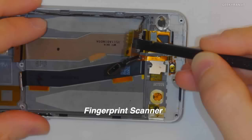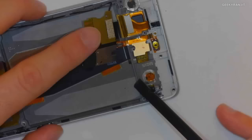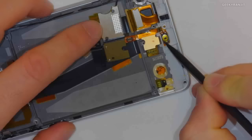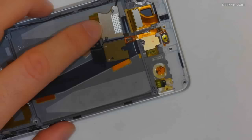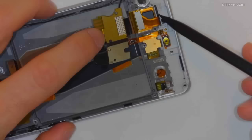Okay, so this is removing the sub-PCB here so you guys can see the fingerprint sensor. It's actually right there. But I cannot take it out without removing this entire internal metallic ring. But it's just down there. And if you listen, I don't know if you can hear the click. Right, that's the little clicking capsule. It's basically a bent metallic cover that always offers resistance. That's where you get the click. And you've got the fingerprint sensor controller right there. That's that little guy.